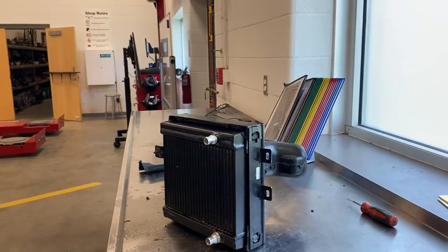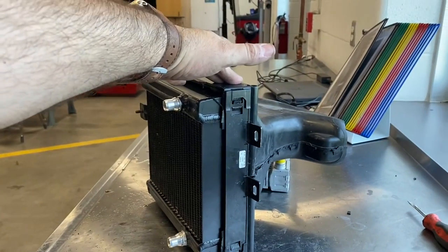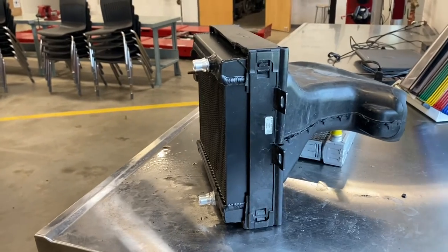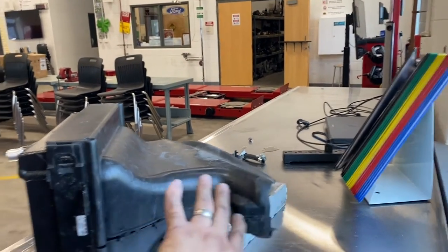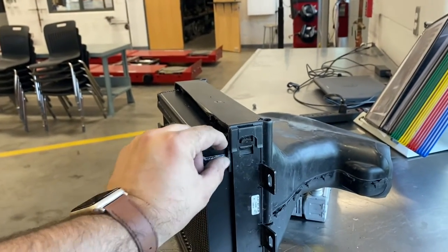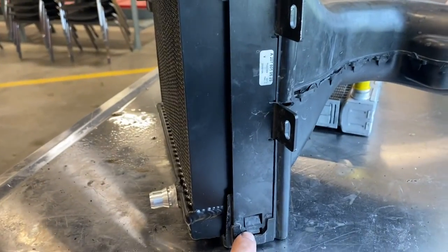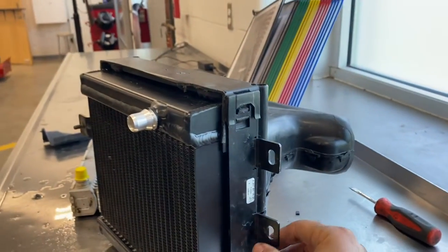Part of this install — and it could be just because of the pure size of this aftermarket unit — is that it's obviously not going to fit in the same size unit. What I actually had to do was cut the back portion. The back portion has a shroud that meets up to the inner fender; I'm not as worried about that. My worry would be this particular part of the shroud pulling the air into the unit itself. The rear doesn't bother me as much. When you put it back together, it's going to be a little bit tighter, but you want to make sure those tabs are protruding because this is what holds the radiator in place.